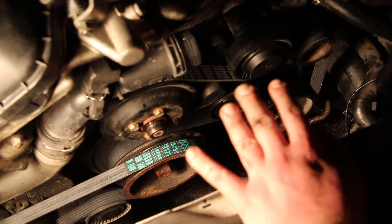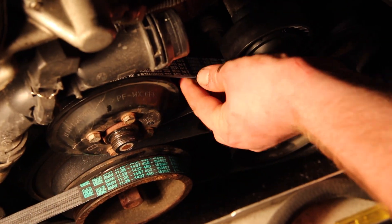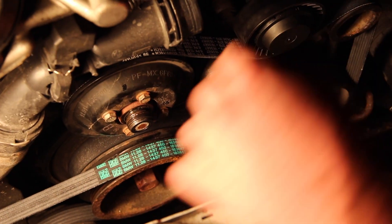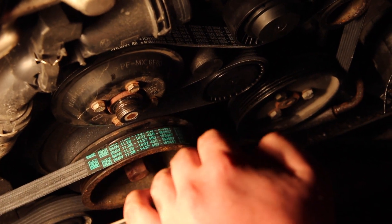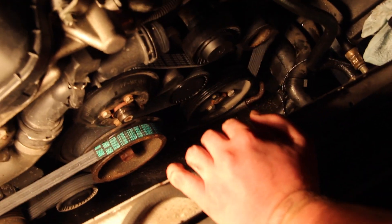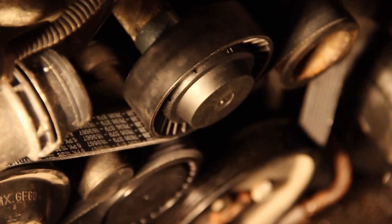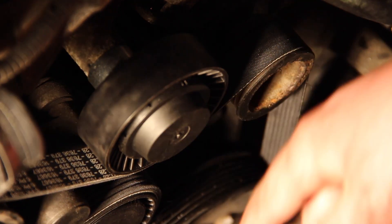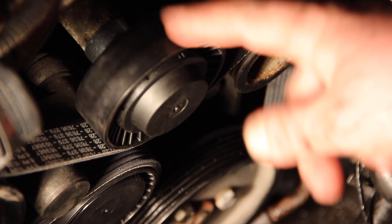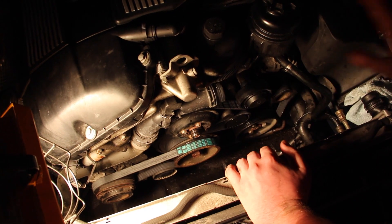When routing the V-belts, just follow a diagram. Make sure the ribbed part of the belt lines up all the way along before you put tension on it — if it's not lined up, the first time you start the car it will shred the belt and you'll be back to square one. I also bought new caps — a full list of all the part numbers used for this job will be down below. Ryan and I replaced all of the bolts. One cap was missing so that bolt was rusty, same story on the other. Fresh bolts, covers on — everything is ready to go back together.